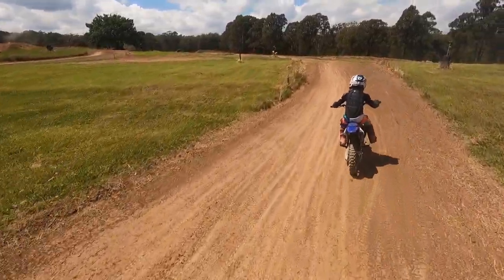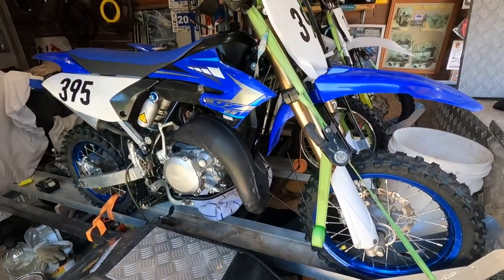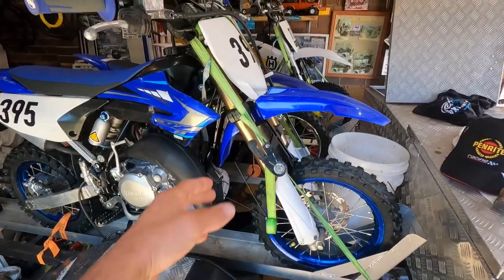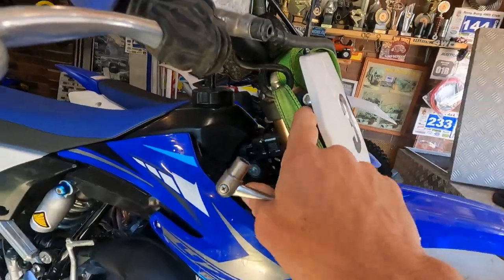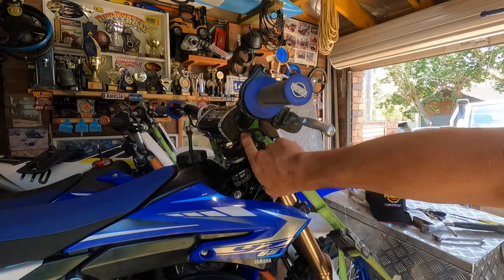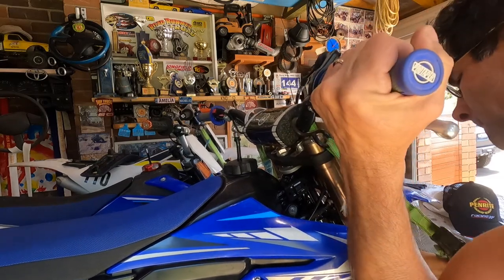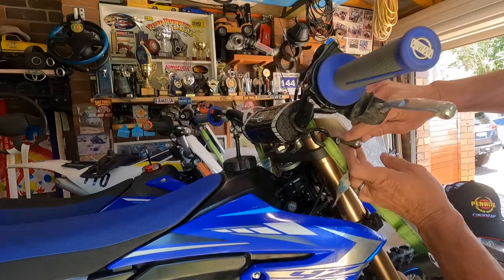On to Nicholas's bike. He was riding it and it was happening, but then I put a brand new Maxxis tyre on the back which might have lifted it 10mm. I'm no bike expert, but there's a little bit of shaft showing. If I undo the triple clamp I can bring that shock up maybe an inch and there's plenty of thread on that back shock. So we undo the two triple clamp bolts plus the one at the top. We've undone the triple clamps and we want to see that fork come up. We've got 5mm - we've just dropped that bike 5mm. I really wanted to come up as close to an inch as possible. I want to see 20mm of this gold shaft. That's 25mm on the dot and we've got the exact same on the other side. Tighten the clamps back up - front's done.